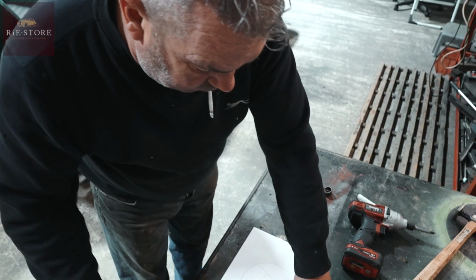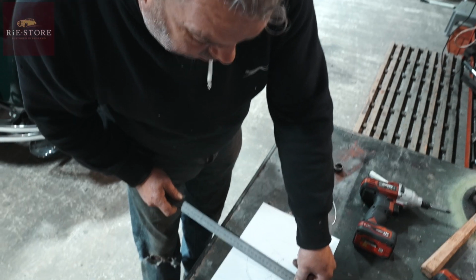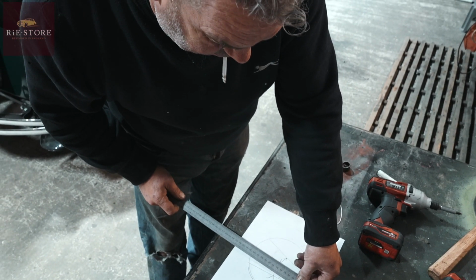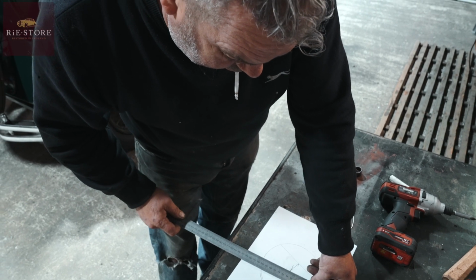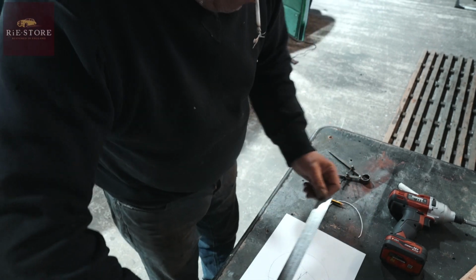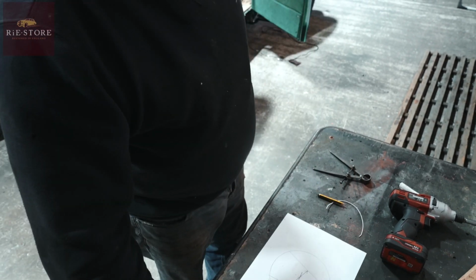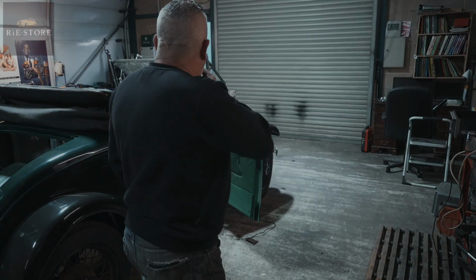So touch the top of your ruler at a given point, doesn't matter where it is. It doesn't matter how long the line is, no. Either. So you put that on there, that's your 0 point, and then you swing that round. Oh, I see, yeah. Okay. Till you get to 120 on the ruler. Yeah. Mark it halfway, right angles, same the other side. Gives you the centre of a circle. Very good. Next week on the workshop.